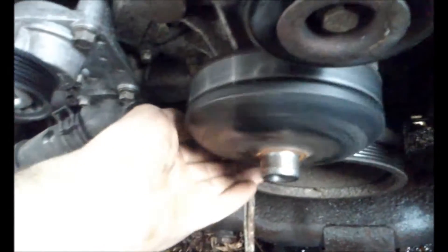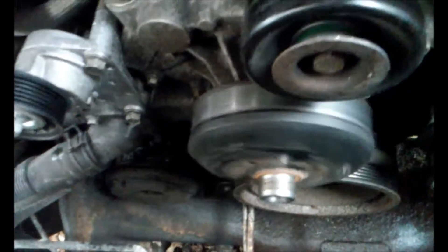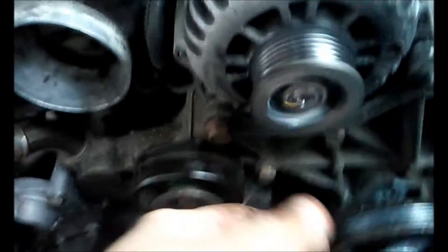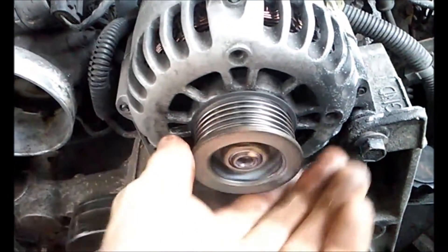As you can hear, it's clearly a bad bearing — my diagnosis was right. Bad water pump. It's quiet, not even spinning right. The alternator/idler was squeaking, but I did put some lithium grease on it, so we'll see if that shapes up.